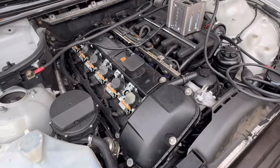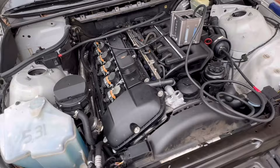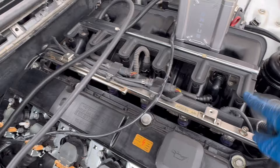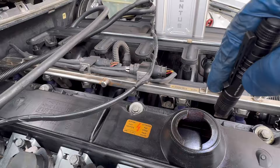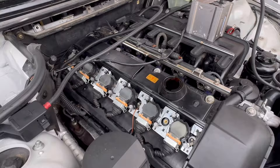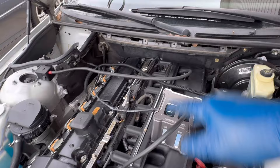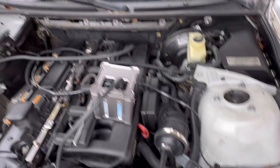Other common vacuum leak points could be the valve cover itself — these things do crack over time. We've been smoking here a couple of minutes and still not seeing any signs of leakage. This air distribution also has O-rings in it that can be leak points. We're full now — we're going to call that good. Just need to button up the trim panels, the one that goes around the brake booster, throw the dress covers on the engine, put our cabin filter housing in, put our air filter housing back in — and then job done. This was about three days doing all of this: the cooling system, belts, pulleys, having the intake off, valve cover gasket. You can easily do all of this in a weekend. Really no special tools other than the smoke machine and the fan clutch tool — everything else is just normal sockets, Torx, and maybe a couple of Allen heads. You can all do this.